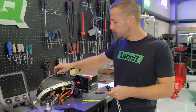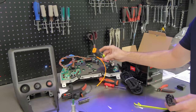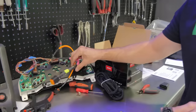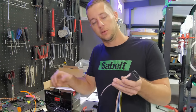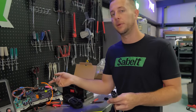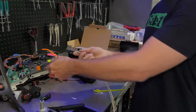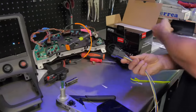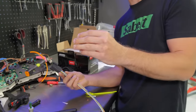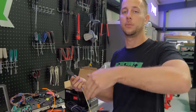Skardig came over and was courteous enough to set me up with the whole pin-out for the S15 cluster, which I could not find anywhere — he has pretty much every chassis memorized in the back of his brain. We have two connectors here. We're going to use the outputs from the ECU that can actually be programmed, so we can take the rotary RPM signal, convert it to the four-cylinder tach signal to make the stock tach work. Same thing with the fuel level, coolant temperature, and all that stuff. I'm making the connector that's going to plug into this, and there's a 12-pin output connector on that Haltech R3 that lets you program your outputs directly off the ECU, so I don't actually have to run any mechanical sensors on the engine — great because I don't want to run more wiring through the firewall.